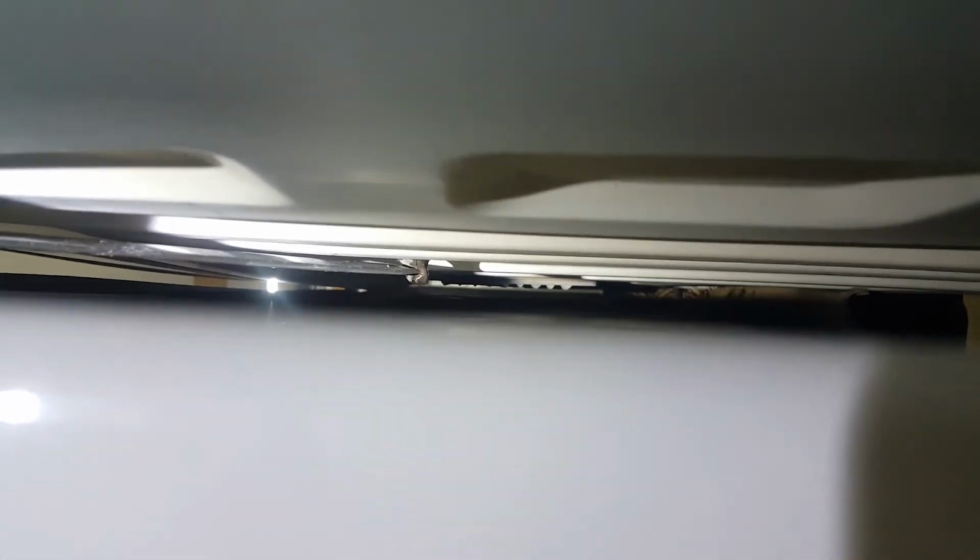Drain tubes in the back also of the sunroof, and those are actually here in between the cab and the bed. You can see this nipple sticking out right here. That's the drain for the back of the sunroof. Okay, kind of hard to get to because there's only just so much room between the bed and the cab itself. There's one on each side. So there's one on the driver's side and there's another one on the passenger side. And here is that drain on the passenger side of the truck between the cab and the bed.